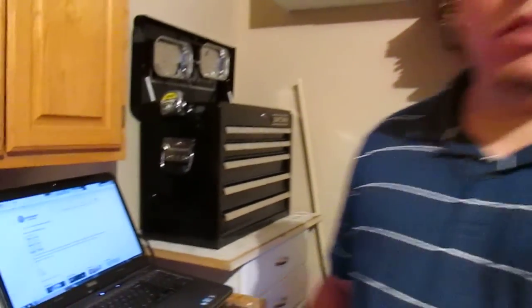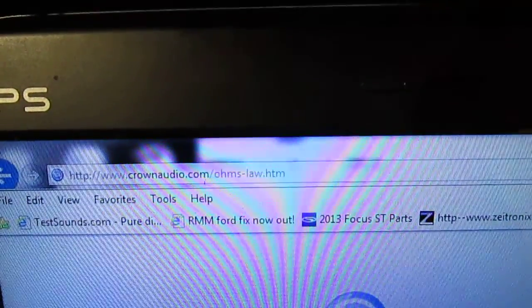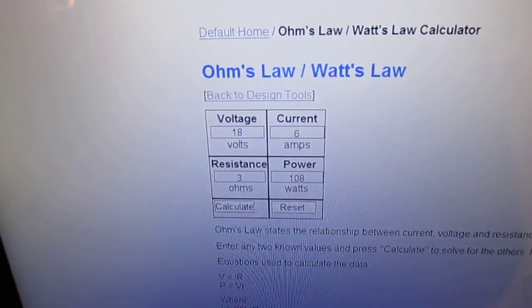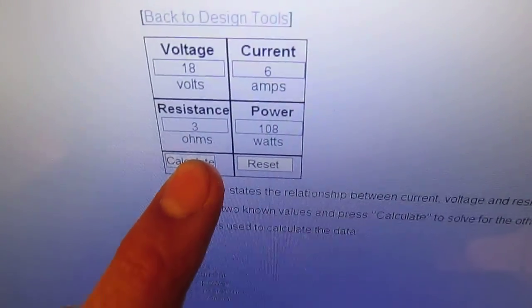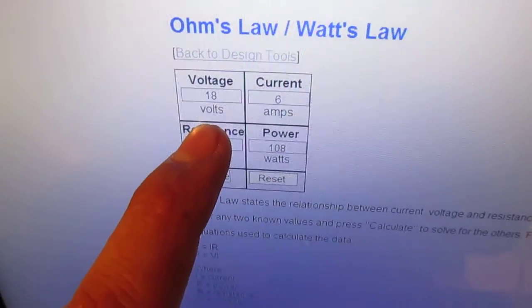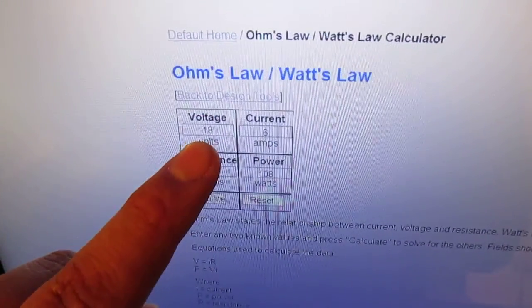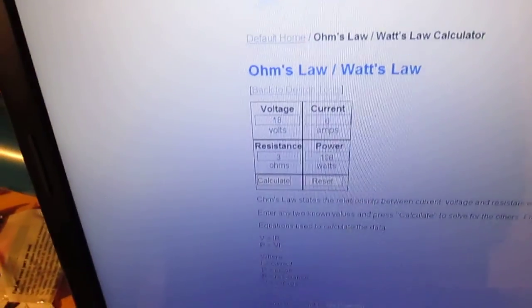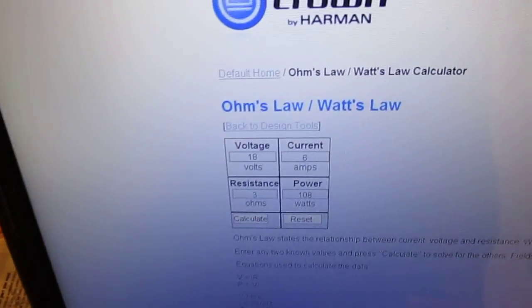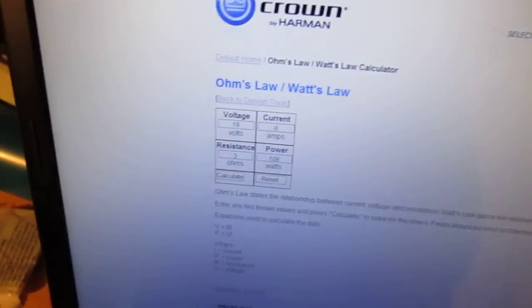So, first website I need you guys to go to, I'll put a link in the description below, is crownaudio.com. This is their little Ohm's Law calculator. You're going to type in the resistance of your speakers. You can type in the wattage you want, and you can get the voltage output. That's what's going to come out of your amp, the max number at any given frequency. When you switch frequencies, it might not go up to that number. It all depends on what frequency is going to be the loudest in your case, depending on your EQ, depending on all that.